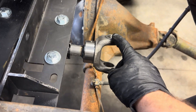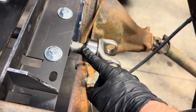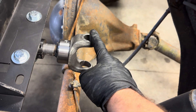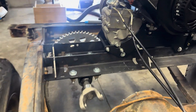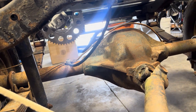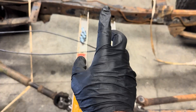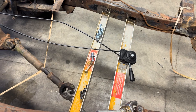This is a 1 inch keyed outer diameter to a 1310 series U-joint yoke that I will run from here. I put it on the low end so that way it can tuck happily in this direction. They actually had that whole setup right here, but that was going to be too much, so I actually did the gearing back here. The final drive will just go from a 12 tooth to a 12 tooth with a 520 series chain connecting the two.